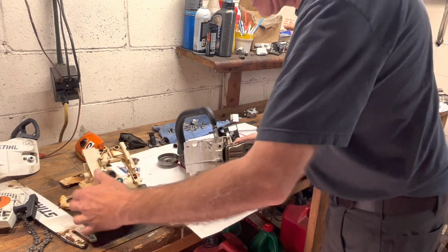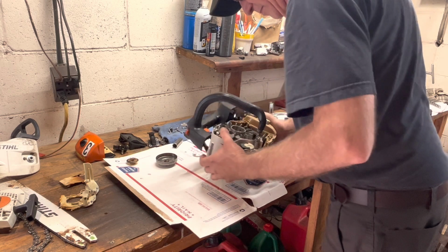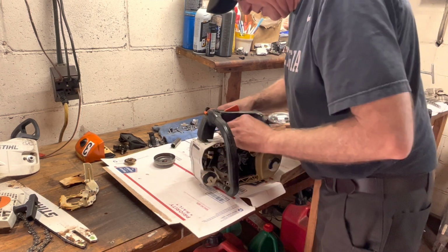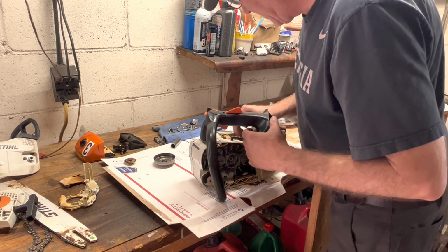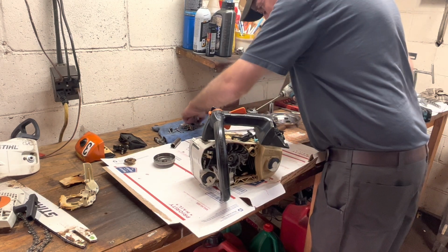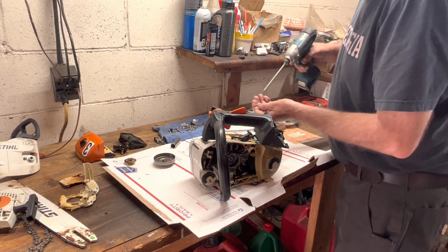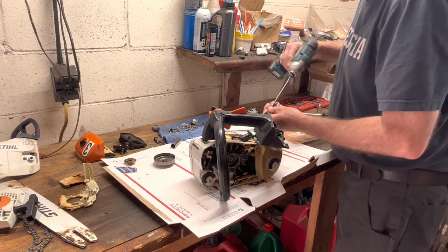All right, let's slide this gas tank on. Lift up, that comes up and over. Let's move that to the side. These have to be the shorter M4 bolts, like that. Because if you try and ram a longer one in there, you will dent the plating in the cylinder, and your cylinder will be no good. Ask me how I know.